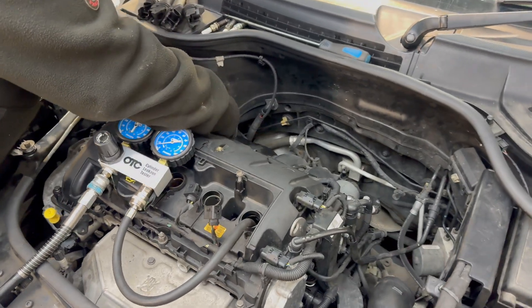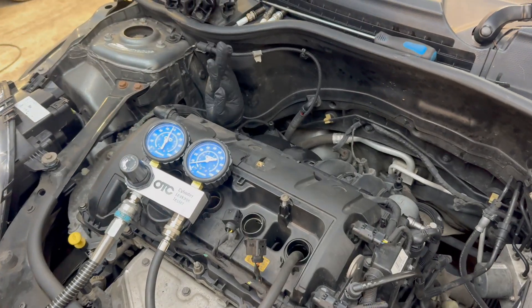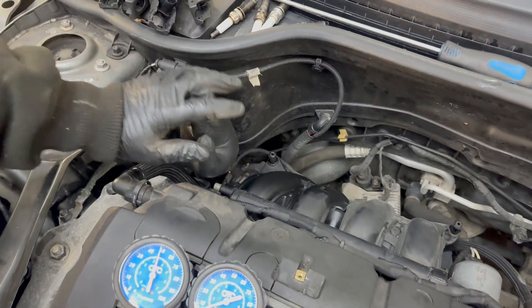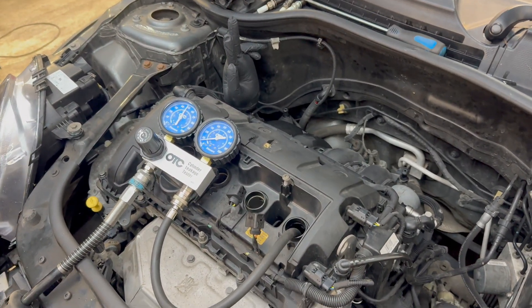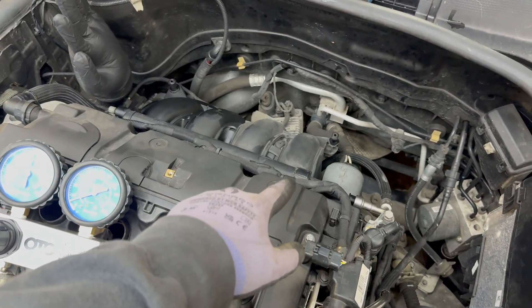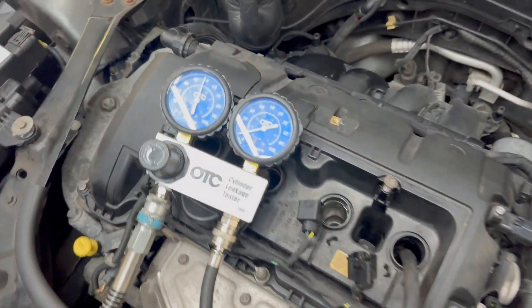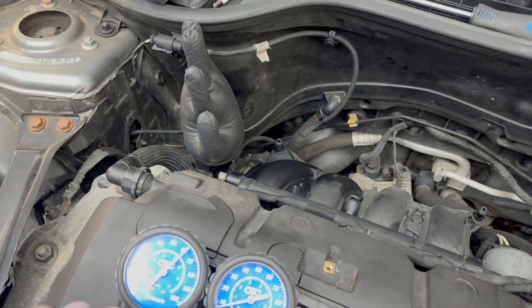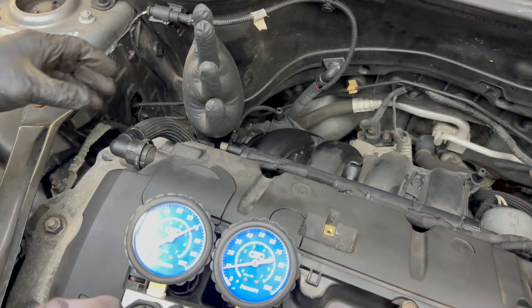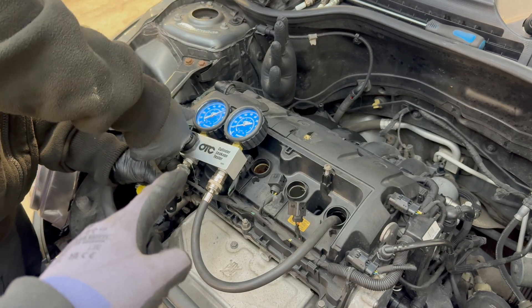Now let me show you where the air is escaping from on this MINI engine. Dan took off the intake box, and where the intake box connects to the manifold, he just put a glove there — demonstrating that the air is escaping on cylinder number 4 to the intake valve, getting into the manifold, and pressurizing that rubber glove. We are not giving it full pressure at the moment, but if I do, it just further inflates the glove. Now we are going to do the same on cylinder number 1 and compare the results.